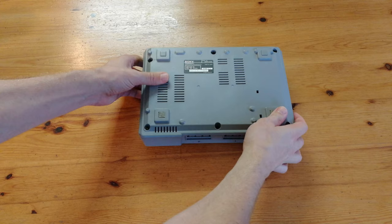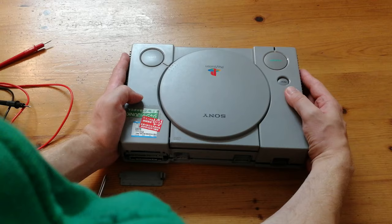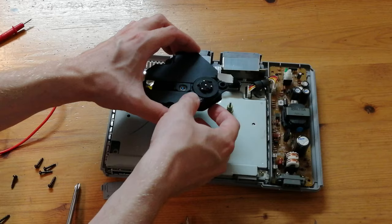On the bottom there are six screws, which we can undo with a posi driver. Being careful with the units, we can now pull open the case. We can then brush away any dust — just going to give it a slight clean. We can now unplug the data cable, then slightly offset the drive so we can easily pull out the power cable.